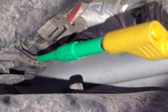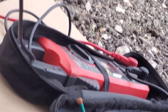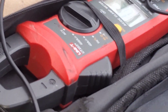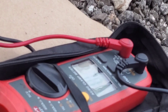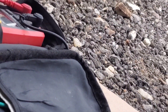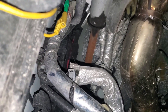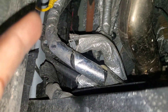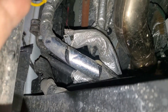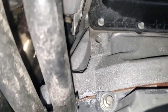I'm back-probed to the gray and blue wire down to my multimeter and I have no signal. That tells me we've got a break before the power steering control module, which leaves the RCM and the trailer brake control module — which is inside the car in the center console. The break is before the power steering rack and pinion, meaning it's inside the cabin somewhere in the middle, so we're going to have to disassemble over there.